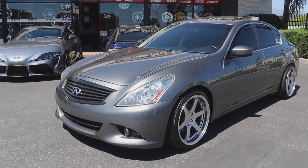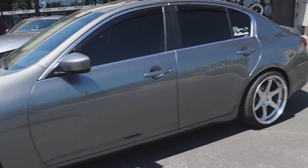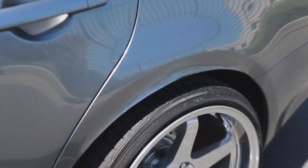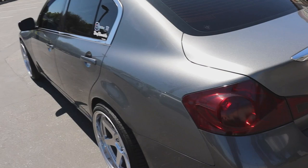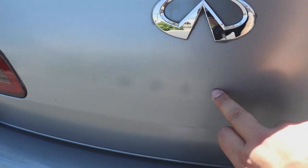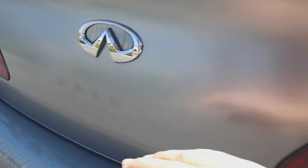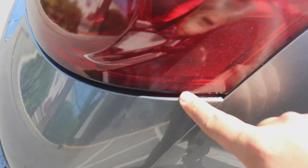We're gonna start with a quick walk around the car. It's pretty much clean and well put together. He has it on air ride, so it does bottom out, and what that's done is basically creased the hard points. We're gonna repair that along with a couple other dings. The paint is still really fresh for what year it is, but in the back he has a couple of cracks and some scars. When he de-badged it you can still see the emblem embedded, so we're gonna cover that up when we paint. There are a couple of little pressure points around the car.